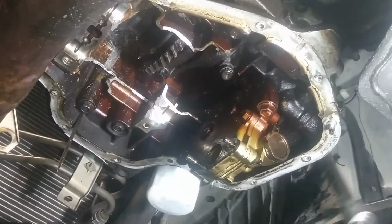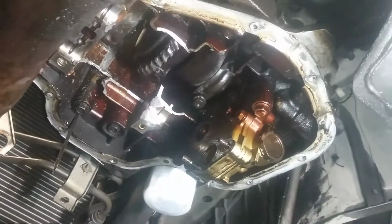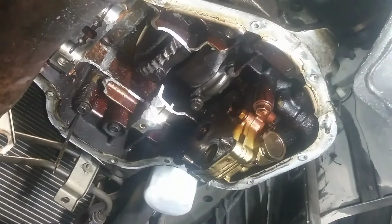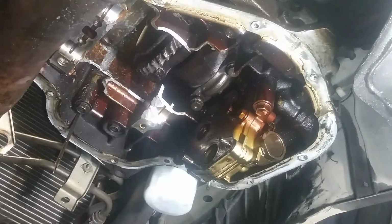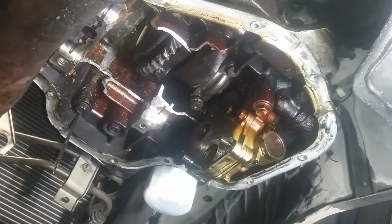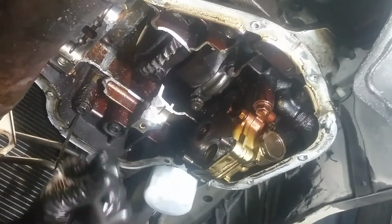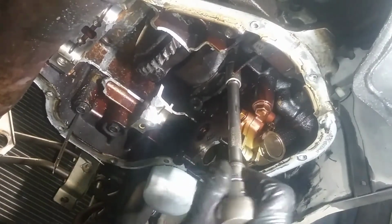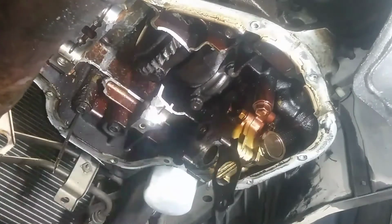I got lucky here. Okay, so I got lucky. So that rod cap likely was why it was so locked up on the number 1 side. We're going to completely remove this rod cap, and I can proceed with removing the engine as normal. The main thing is I need to be able to get to the torque converter, all the fasteners holding into the transmission. Once I get all the bell housing bolts loose.